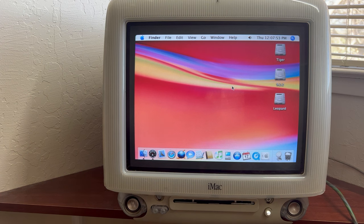Like I said, when I tested it before, it was very slow to eject things, but now it's just that belt is so stretched out, and that's what happens with these particular drives, is that the drive belt gets stretched out. But it's really easy to replace it, and then once we're in there, we'll just kind of lubricate things, and it'll work just fine for another 15, 20 years.